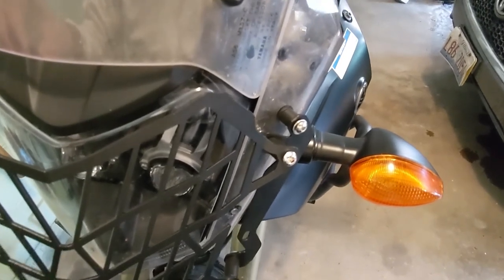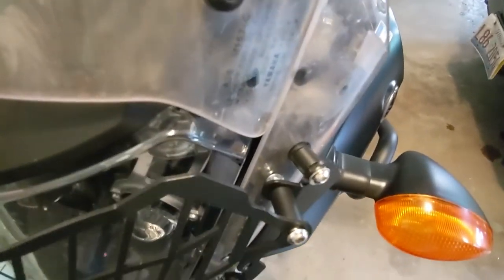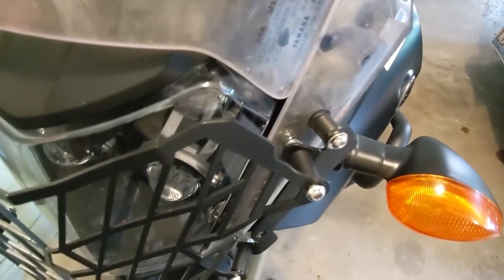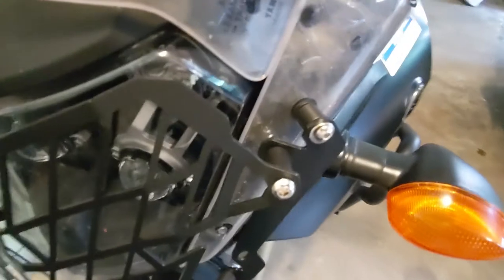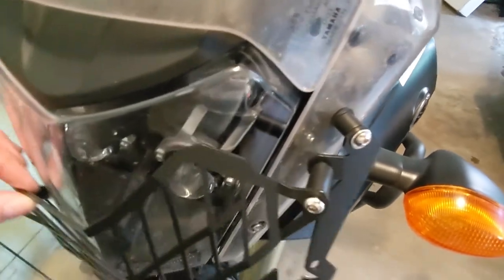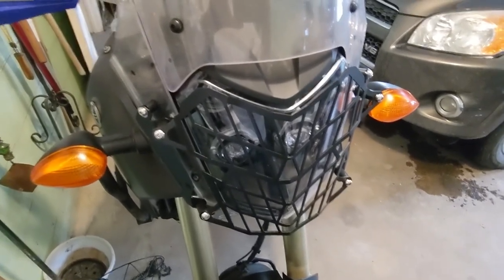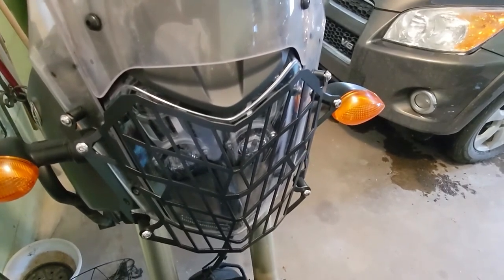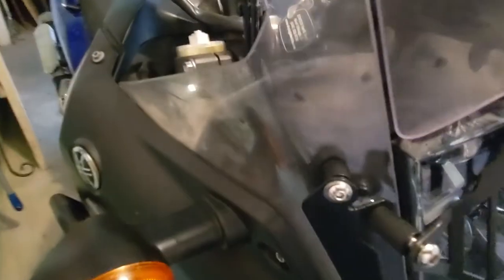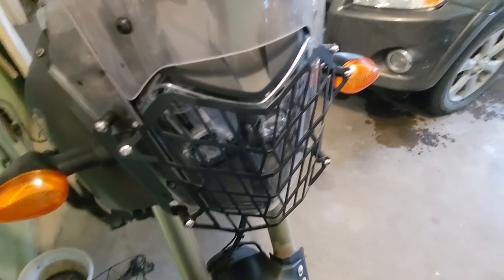I just put in the top right bolt. The smaller diameter bolt goes through the bracket with the metal washer behind the bolt, then the short spacer goes on next, then the rubber washer from the bike, and then go ahead and screw it into the hole where the original OEM bolt came out of. I'll attach the other side and show you what that looks like. That's just the top two bolts in place — that should fit right on without too much trouble. Use a number three Allen wrench to secure those bolts to the bike. This one here is a number four Allen. Everything right now is loose — until I get all the bolts in, I won't tighten anything up.